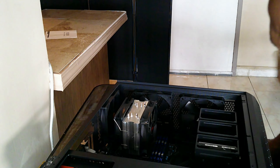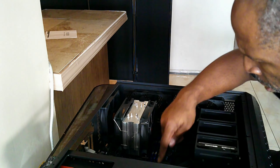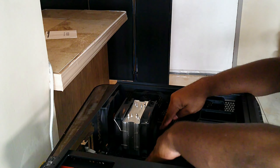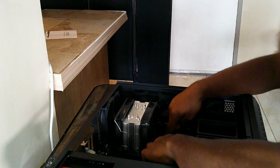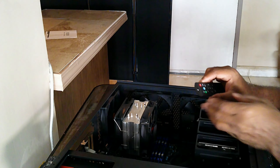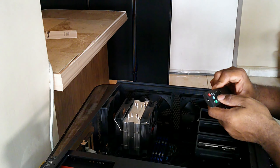Give me a minute here - the black metal back plating is getting in the way, so I might have to remove it because it's not fitting in there properly. It's pushing down on my memory slots and loosening up my RAM. I'm going to make some modifications - give me about 30 minutes to fix these problems.